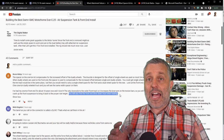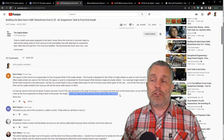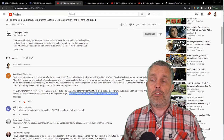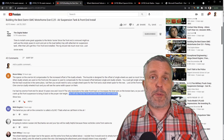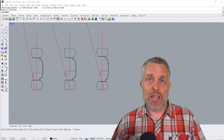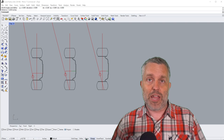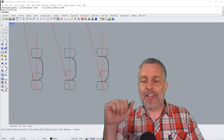I was clued into this behavior by a comment from Bruce Hillsop, who told me that with his same spacer on his motorhome, under braking the front end dives down — and that's entirely attributable to those two inches of extra lever arm at the front. The spring rate on those torsion bars is no longer tuned for the suspension. This is a case of 'never deviate from stock': deviating in one thing — steering axis or wheel spacing — has many cascading consequences, and you have to change all kinds of other things, mainly the springs. But I have no idea what metallurgy and spring rate I'd need, and where would I even buy such a thing?